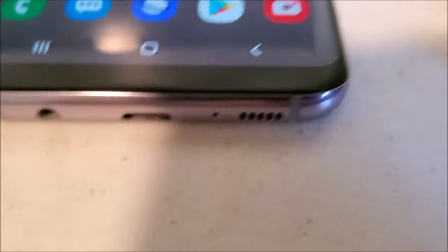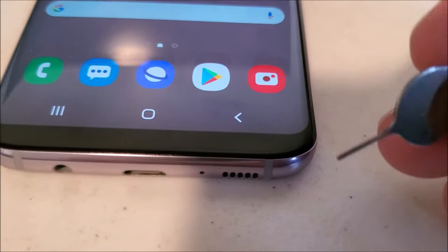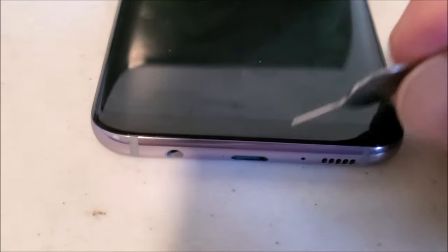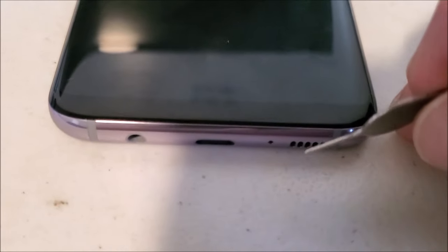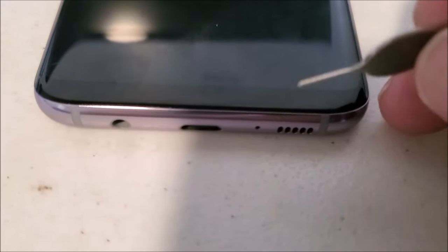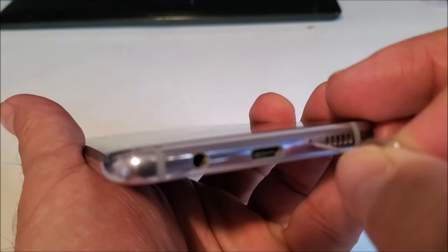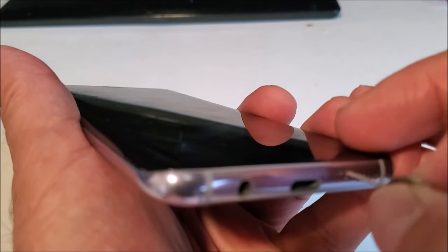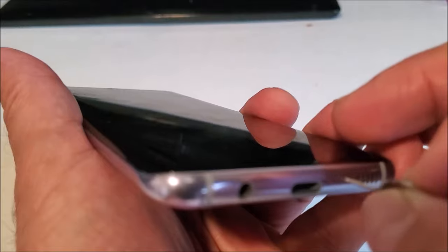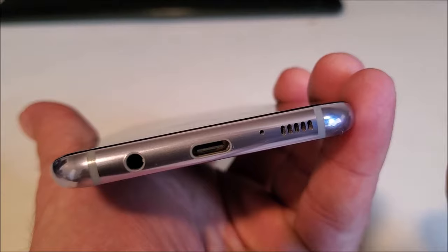What you want to do is get a little pin — if you have the SIM card pin, that's perfect. It'll fit right in there and you can go in and clean it out. One thing to be careful of: you don't want to push in very far because you could damage the microphone. Go real slow, just barely go in and clean it out a little bit, then test it out and see how it works. You just barely want to go in — don't push too hard — and just clear out the hole a little bit so that the dirt doesn't block the sound from getting through.